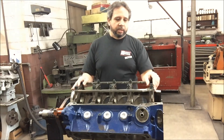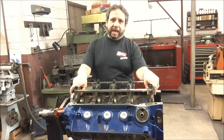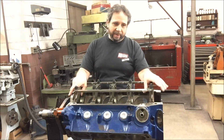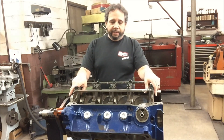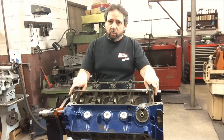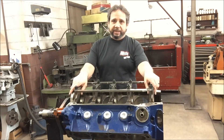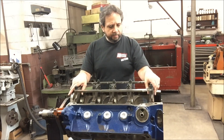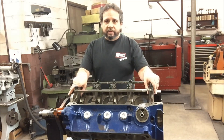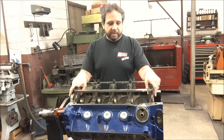My crankshaft — I think it's a Scat crank. I got my rotating assembly neutral balance from Mark McEwen way back when. I think it's a Scat rod and Scat crank, cut down on the counterweights for internal balance, which is cool. Tim Meyer's doing the same thing now — cutting it down so you don't need the Mallory metal. This has the cam bearings that are restrictive, which seem to work well, rather than plugs in the mains like the Roush can.